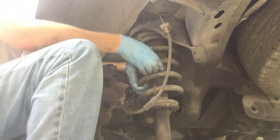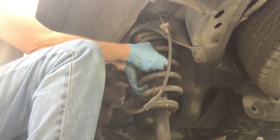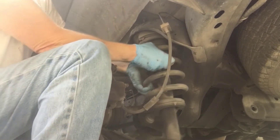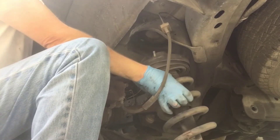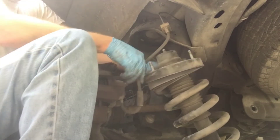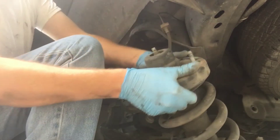We're down to the last nut. I'll hold it up with one hand and take that final nut off — still have to use a wrench because it's a lock nut — while holding it up because it's just going to drop otherwise. Final nut's off. Now it's the moment of truth: can we wiggle this strut out without pulling the caliper? No problem at all.